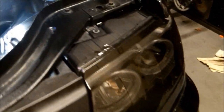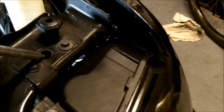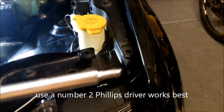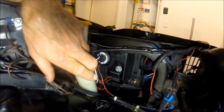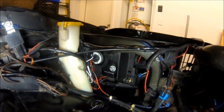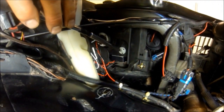With the headlamp installed, all we've got left is to show you how you adjust your front headlamp. This is where you adjusted it originally — there was a bolt sticking up here and you'd stick a socket on here and turn it left or right to make it go up or down. You're going to do the exact same thing, except you're going to use a Phillips screwdriver — find one with a fairly long shaft. If there's an air box in the way, or on the other side where you have a battery and fuse box, you could not get to this Phillips screw.